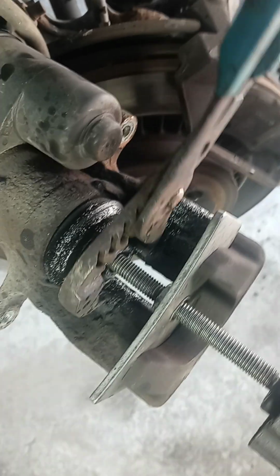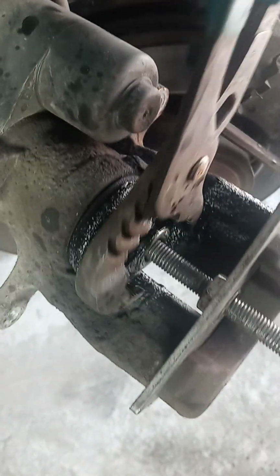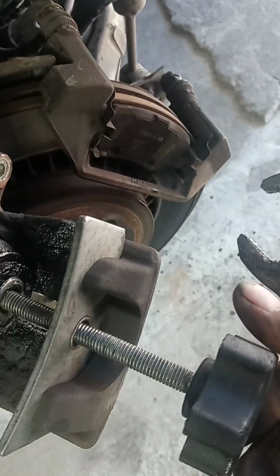Get my channel lock set just right here. One turn. See how I'm using the channel locks? Catch the end of the piston and turn it clockwise. You turn it about three times and then tighten your pusher up about three turns. Just keep alternating back and forth till you get the piston all the way in. Need a cameraman, don't it?